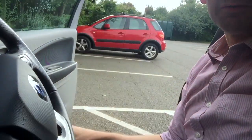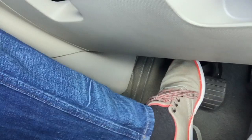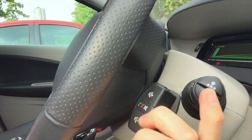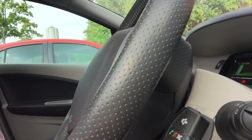First of all, what you need to do is have the car charged to a hundred percent, which I've done. Keep your driver's door open, which I've done. You then put your feet on both pedals and press them down. Once you've done that, hold the stalk on the bottom down to reset. I'll do that and show you what I get on the dash.